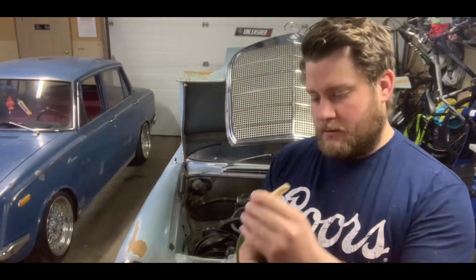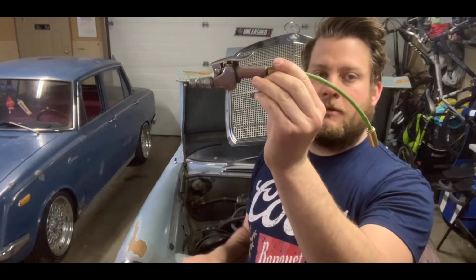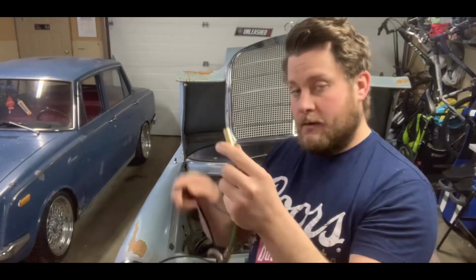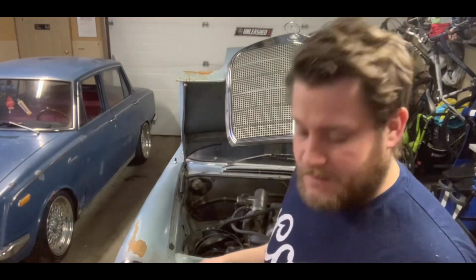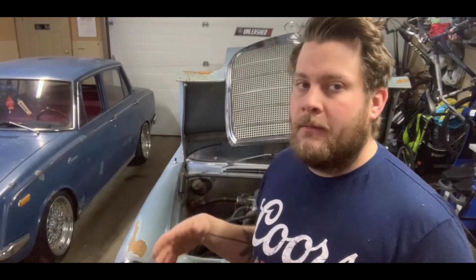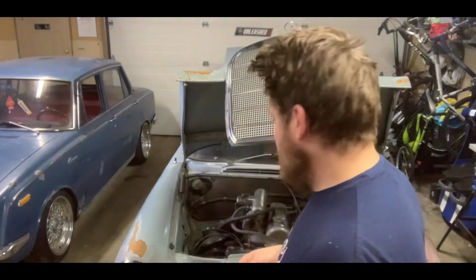So, as you can see, all I have is just an air tool that I put a quarter inch airline fitting and adapter on so that I can hook up to the airline that's attached to the driver's side airbag. I also had everything teed off earlier, so I was able to lift up the front end at the same time. But I obviously don't want to be running both bags off the same airline when the management comes in, because then it'll just slow down the process and I'd rather have better control of all four corners on top of just having the front and the back operate together.